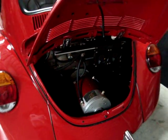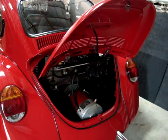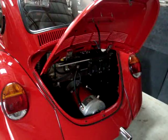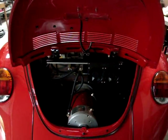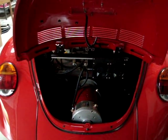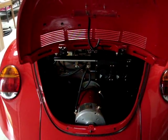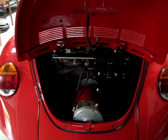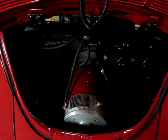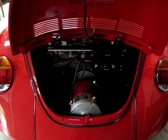Anyway, that's what the Karmann Ghia will look like, basically — a little different design shape of the engine bay, but the conversion will be about the same. The heat sink and so forth. We will have a blower motor for the electric motor for cooling, as the Karmann Ghia doesn't have the same airflow. We'll have the enclosed engine compartment as this Beetle has — you can't see the ground, and don't have to worry about debris, water, or anything else getting into your engine compartment.